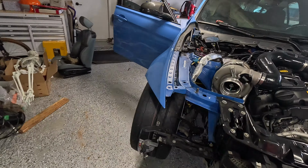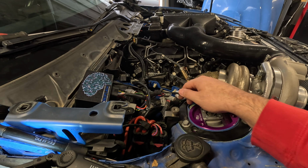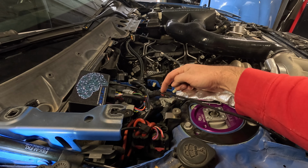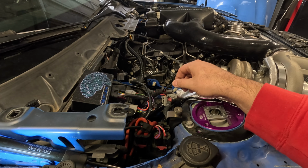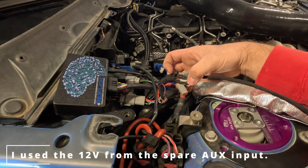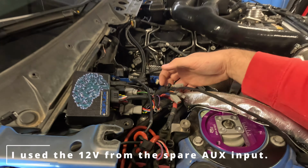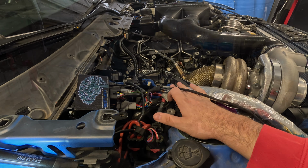The 5 volt, I'm not too sure about. And the max solenoid, I routed it to the pin 31, which is this white loose wire that comes on the Reflex, and then to a 12 volt switch. I believe I took, actually it's one of these red and blue or red and light blue harnesses. Those are auxiliary and extra inputs.